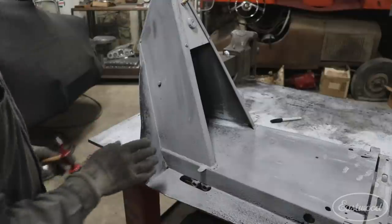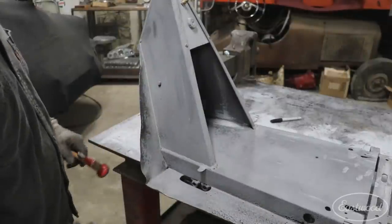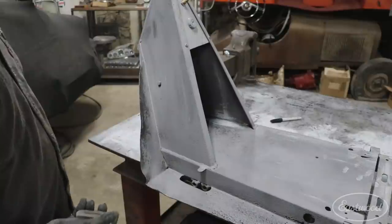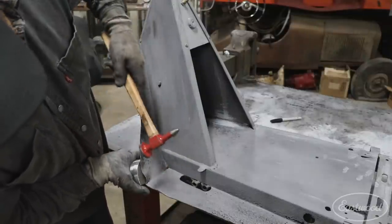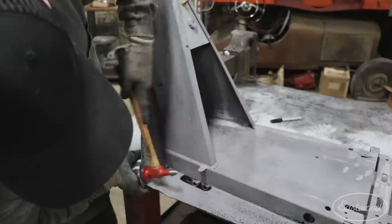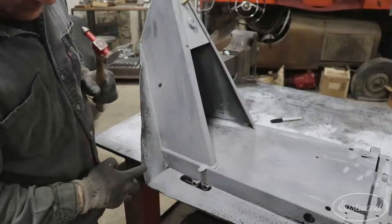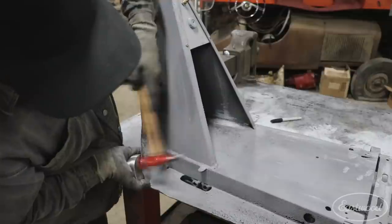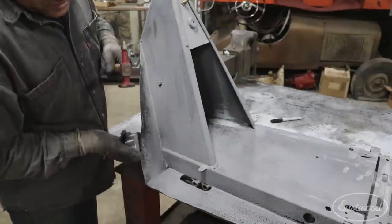First thing I want to do is get some of this metal here that's out of shape straightened up real quick before we start working on this rusted area. I just want to kind of get these pieces straightened out. Now this is a little bit thicker of steel - it's not like a 20 gauge, I think it's probably like a 16 gauge steel, so it's going to take a little bit more force, but it's the same no matter what. We're going to start by bridging this little spot here - we're going to tap right in the center and keep working our way across, working this low spot up to even it out.